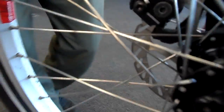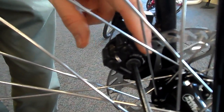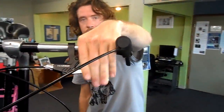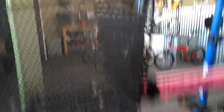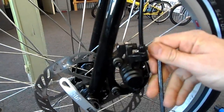On the back side over here is the adjustment for the stationary pad. I'm going to dial that all the way in until it stops. Then with my fingers on the brake lever up here, I'm going to give that a good squeeze. And as I'm holding the brake lever, I'm going to tighten these compression bolts.